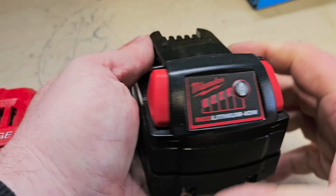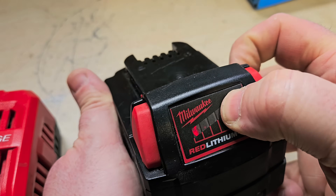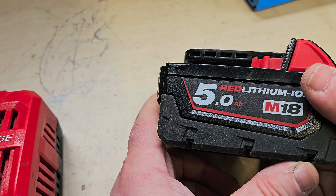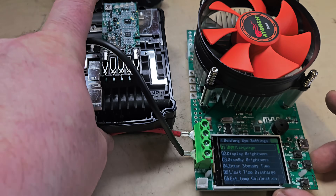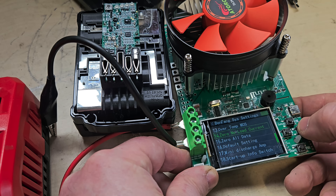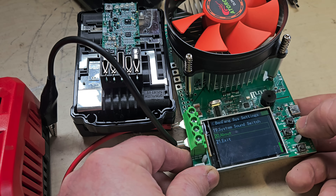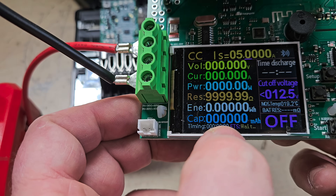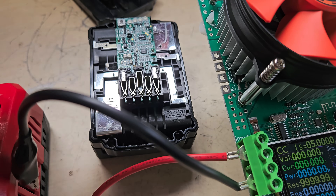But the question is - this battery's been fully restored, it's in its original casing, original cells, everything's original. Because that bank of cells was so low, sometimes there's a toll on the cells and they're just not holding up as well as they should. So what we're going to have to do is take it apart again and put in a load test. We have to set the cutoff voltage at 12.5 volts. What we're looking for is the watt hours - this is supposed to get to 90 watt hours if it's a good battery, if it's as good as new, it'll be 90 watt hours.